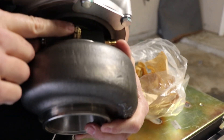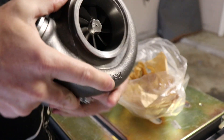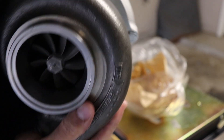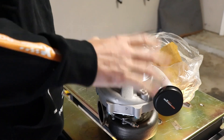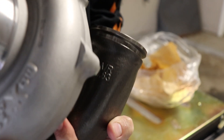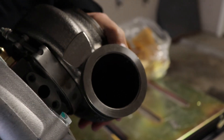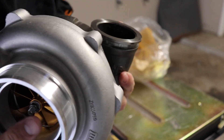Just a feed line to the feed, your traditional-style drain, and everything we need to hook up the coolant passages. Let's take a look at the exducer side — the exhaust, or turbine side. This is a pretty big back housing. The AR on the front is 0.75. It's a ball-bearing unit. The AR on the exhaust housing — you can see it says 0.83. This thing is a hefty unit. It has a V-band style inlet for the exhaust side.